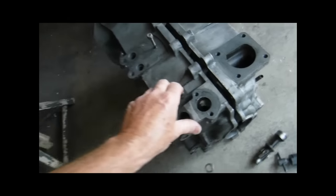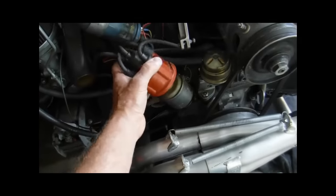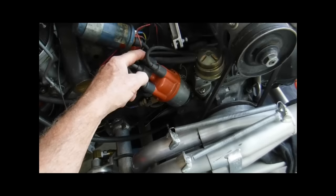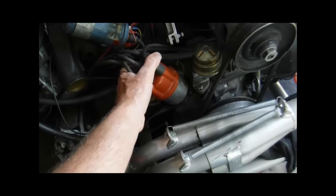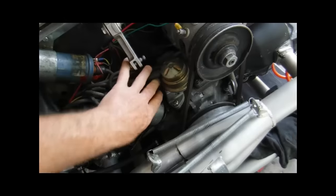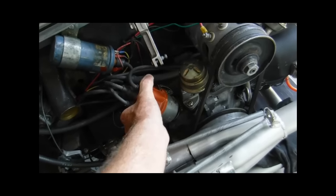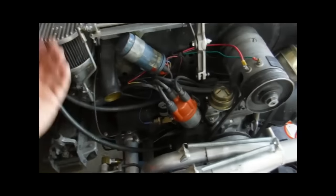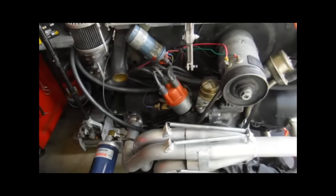It's not the end of the world. It just means number one spark plug is going to be over one position instead of being this number one. This is going to be number one — firing order 1, 4, 3, 2. I've had engines that I purchased that were in cars and assembled wrong, and they still ran. Not a big deal. It's going to confuse the heck out of the next guy if he doesn't know anything about it, but it'll work. So don't panic. You do what you think is right. Thanks for watching, thanks for subbing. Easy Jeezy, out.